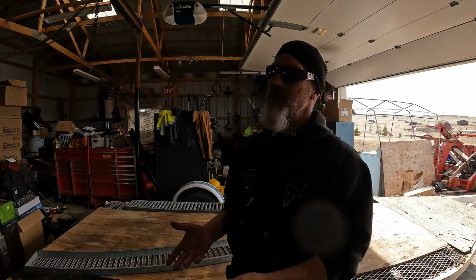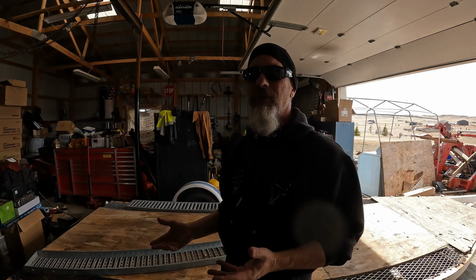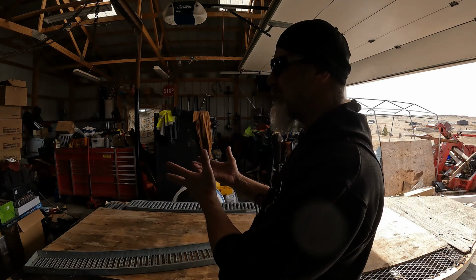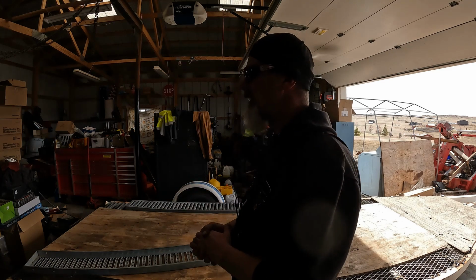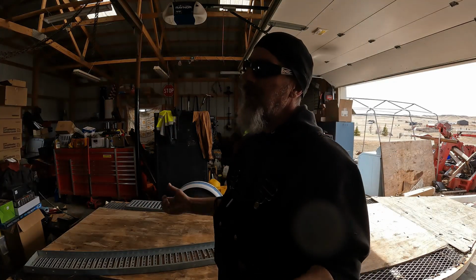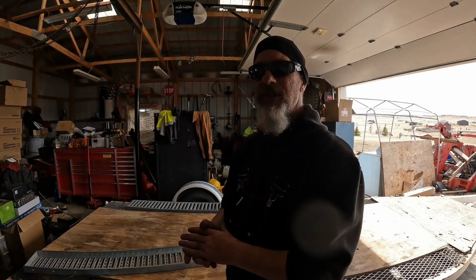Oh, it's a boat trailer, so the framing is different and stuff like that. But it doesn't matter if the framing is different. Turn around, you put in your cross members or ribbing, put in some runners, and you're good to go. She'll be a good trailer. Instead of going out and spending between $4,000 and $8,000 on a trailer, you can turn around and refurbish that boat trailer.